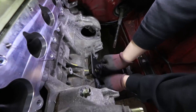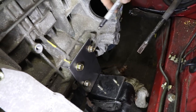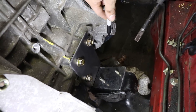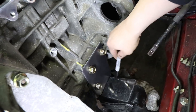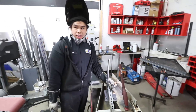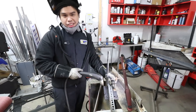So this should ideally be our last test fitment. We're at our final stages of getting this all put together. At this point what we're going to do is try to shape this metal to look aesthetically nice and get it ready for connecting this piece to this piece. Being that it's all custom and we're not really sure how these things look, we're going to have to cut off a bunch, make it look nice — probably box it in from this side to here, here to here, and this corner to this corner, and that should give us a strong weld. I see you've resorted to using a plasma cutter here — why instead of the bandsaw?